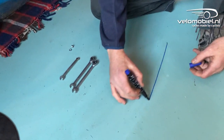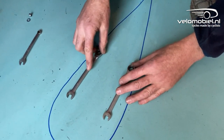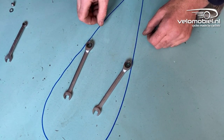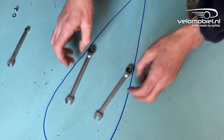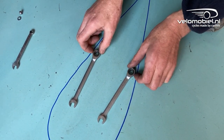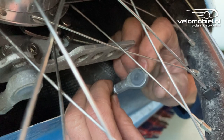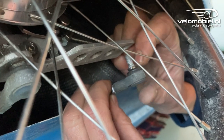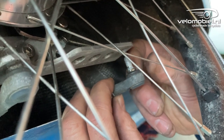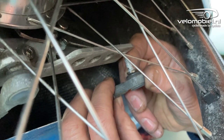On this Quest, the front wheels have a little bit of toe-in, so the front wheels are closer together at the front. We need to adjust the steering rod — we need to make it shorter in order to get the wheels parallel again. I rotate the ball joint of the steering rod further onto the rod so the rod gets shorter, and each rotation adjusts about three millimeters of toe-in, which was about the toe-in we measured on this bicycle.